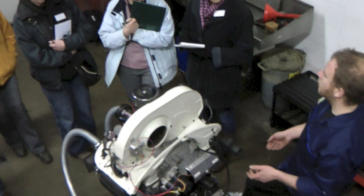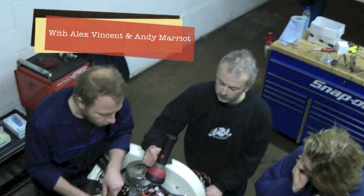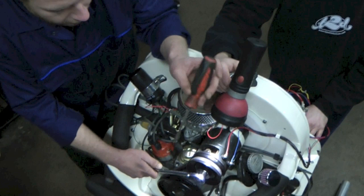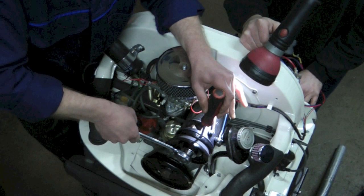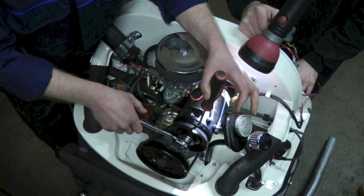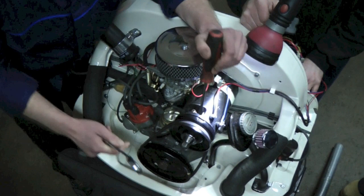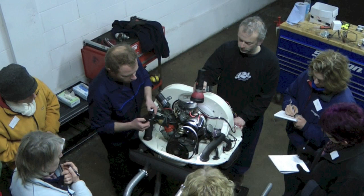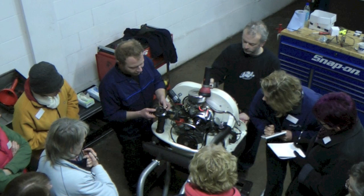This corresponds with a little screw head that pokes through on the end. This is the screw itself going through, holding the dynamo together. So you can get a screwdriver — not a ratchet one — and you can just pop that in there to lock that up. Basically you've got to stop the pulley spinning so that you can undo the nut, because the nut's quite tight. So you simply undo that. This is in two halves. These shims are also how you adjust the tension of the fan belt.